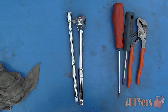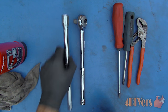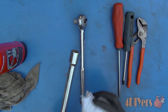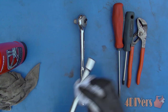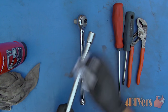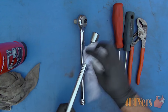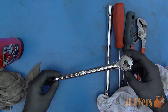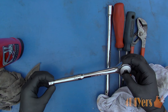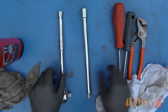Polish up those chrome parts. Use a chrome-specific polish — don't use any compounds or any other types of polish as this can jeopardize the chrome plating. Chrome plating is only a thin layer of coating, and once damaged, this will need to be re-coated to allow for the same protection and finish as new. Use a clean soft cloth, apply the chrome polish, and then work it into the surface. Applying a polish will not only increase the shine but provide a light layer of protection. Only light scratches will be removed; anything more extreme will remain.